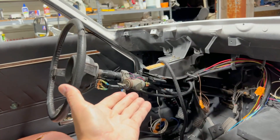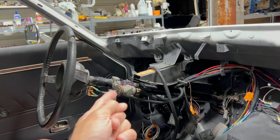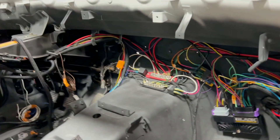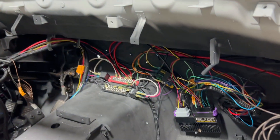You could do it, but I don't know if a 1978 switch is up to the task of running all that current through it. So to be safe, I ran a big 30-amp relay to run the injectors and coils and all that.